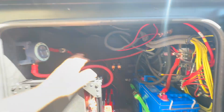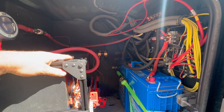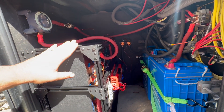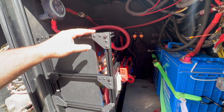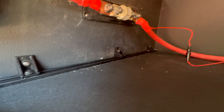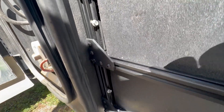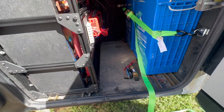We've got a shut-off and fuse already run, along with a shunt. Everything is kind of laying around because we're just trying to get it going — we'll clean it up before we send it home. This battery was kind of a beast to install. It's made out of 2020 aluminum extrusion — like what 3D printers use — which provides compression, keeping the cells nice and secure. We used the mounting brackets to attach it to the back wall, screwed right through the framing, and ran Unistrut for additional support in the bay.